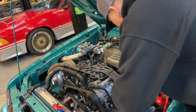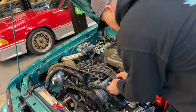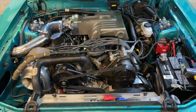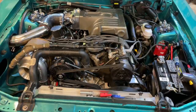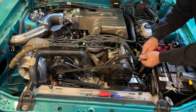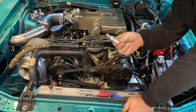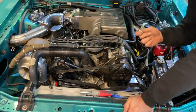This is going to be really loud because we don't have a plug back there, so just don't mind that. Remember, if you're going to do this you need to ground out the spark plug. I'm going to start the car up, then switch the camera off and review the footage because this is going to be extremely loud. All right — I just reviewed the footage and it looks like the spark plug is firing. So that's good. I'm going to go ahead and put this thing back in and hope for the best. Hopefully that's all it was — the anti-seize was keeping this plug from firing.